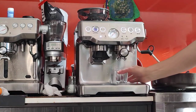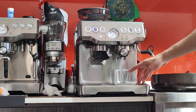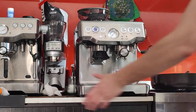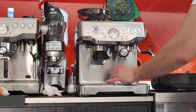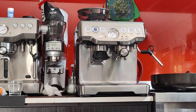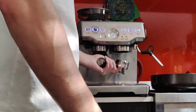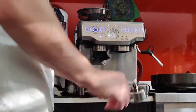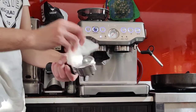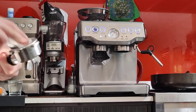Perfect. So this is the double amount that's programmed — when you make an actual coffee it won't be all the way to the top, it'll be close to three quarters. These buttons are programmable so you can change them to whatever length you'd like, and I'll teach you how to do that in a second. You can do the blank shot once or twice — it'll warm things up and make sure you're getting a piping hot shot of espresso. It will also clean components like the group head and the basket by running water through, stripping away any coffee oils or grounds, which is good.